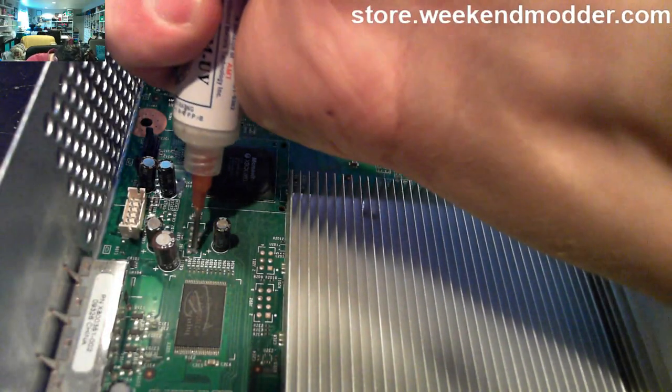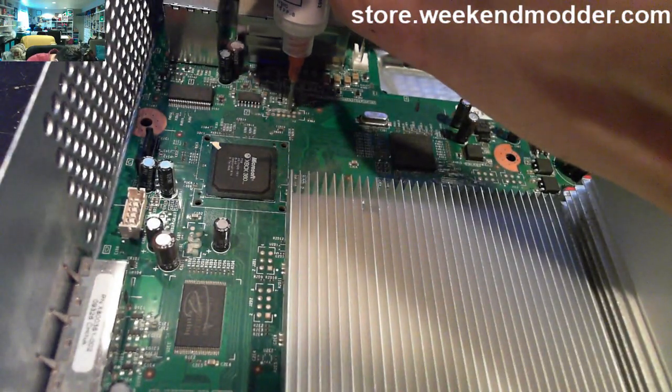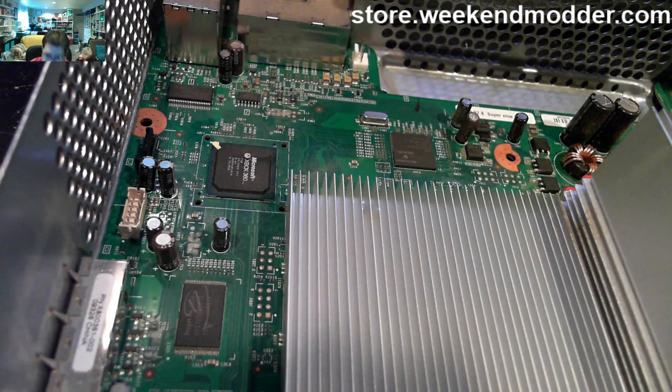Now that we've scratched off the coating, we're going to go ahead and put a layer of flux paste down. This can be scored off Amazon or eBay for just a couple of bucks as well. It's just a kind of thick consistency flux, which is not optional. I frequently get asked if you can kind of skip the flux. Certainly no, especially if you're using non-rosin core solder. You definitely want to make sure that you're using some flux there.